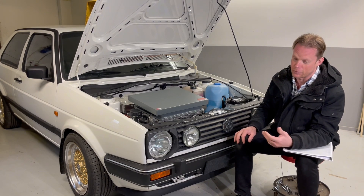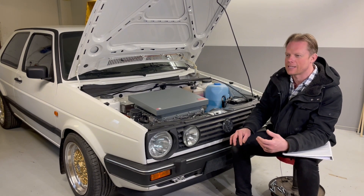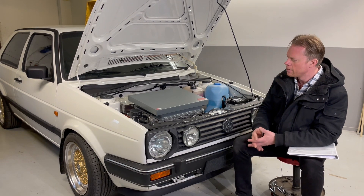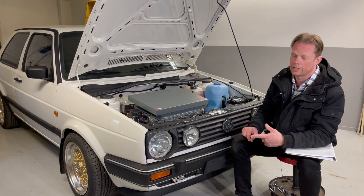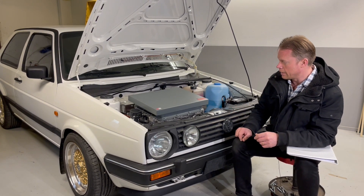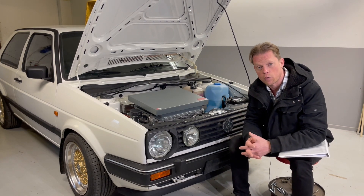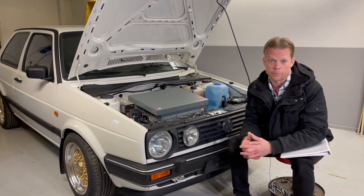Looking at the behavior of this BMS, it doesn't seem to look much at the cell voltages — it just seems to count the amount of current that leaves and enters the battery. I thought it would cross-check more with the cell voltages, but I can't see that anymore. Maybe the 24 kilowatt hour BMS is a little simpler than the newer one. Anyway, I changed that BMS and tried the DC charging again without success, did more troubleshooting, and finally found that I had old software inside the Resolve EV controller. I have now updated that and that's pretty much where I am right now.